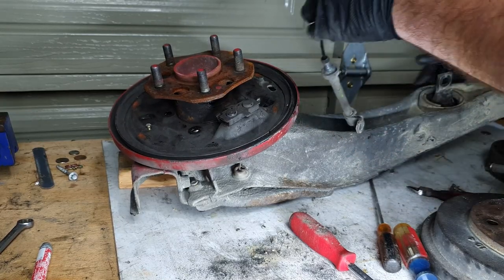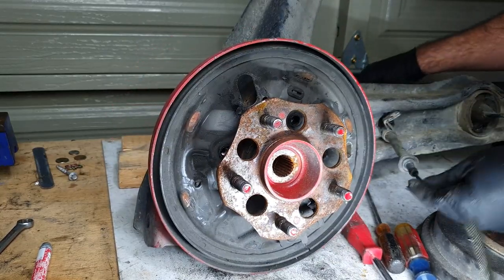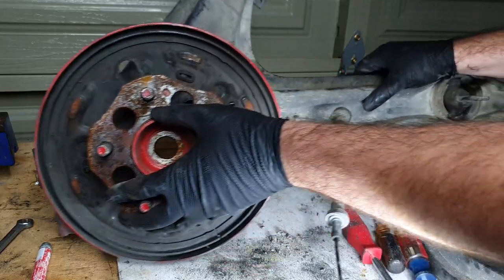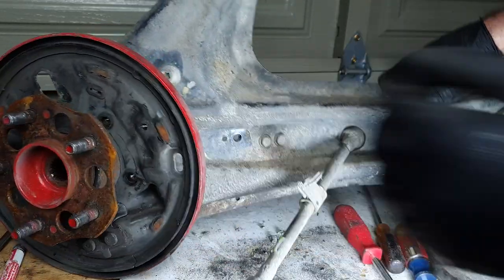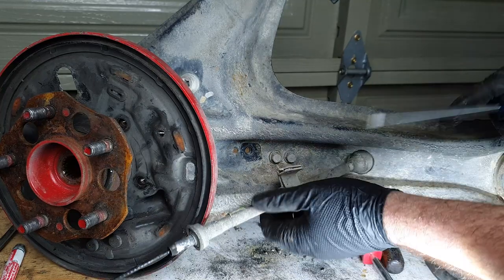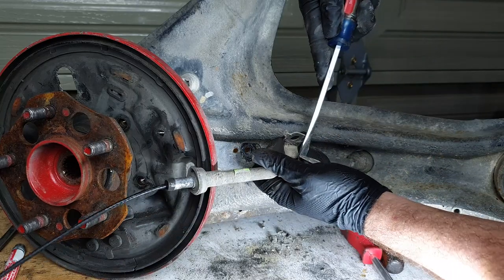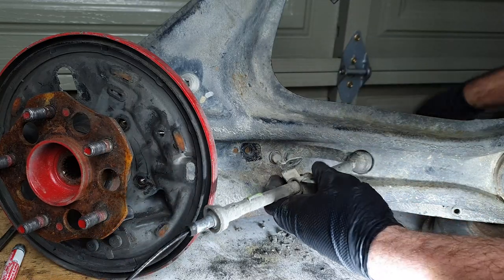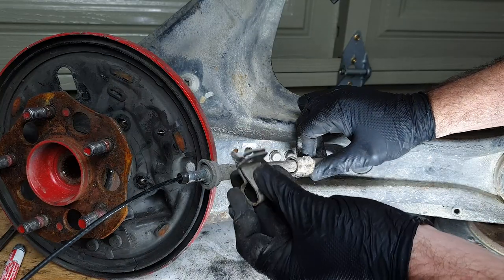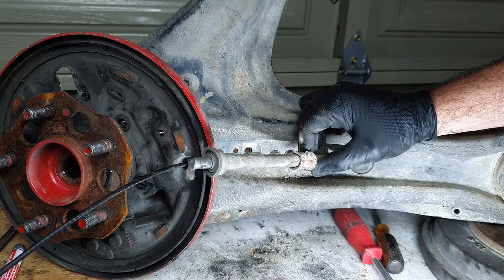Getting it all pulled off, because you're gonna need your handbrake cables anyway to go with the disc. So get rid of this handbrake cable. Like I said, there is another video, link in the description or above. It shows you how to remove the handbrake cables and the drums. These are handy to keep. These clips, these P-clamps, I definitely chuck those in a box.